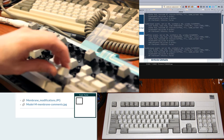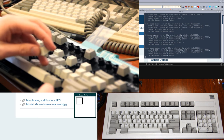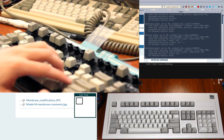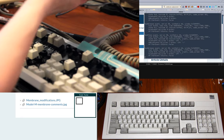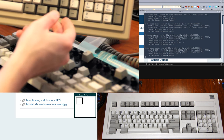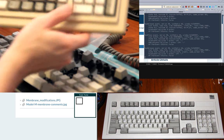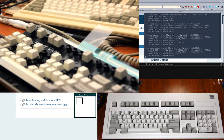And I have noticed a slight acoustic difference. Some of these keys do feel a little bit more solid, or sound a little bit more solid. It's so hard for me to not conflate the feel and the sound. By the way, the shift key and the slash key are swapped here because this keyboard, which is the temporary one I was using, does this, where it has the shift key here and the slash key on the other side of these arrow keys. And I never use right shift, basically. If I do, I'm reaching to the very edge anyway. So I swapped their positions in the key map, and I just use shift as my slash and question mark key. But I didn't flip that around yet. And I don't have the keys to type the command to do that yet.